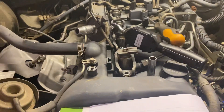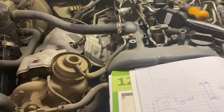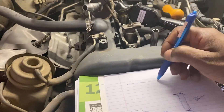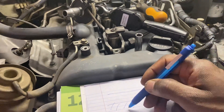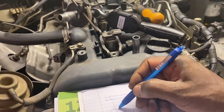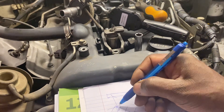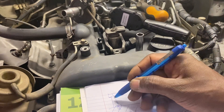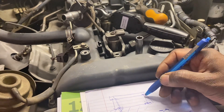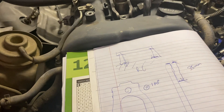These bolts have to be tightened to a certain spec. Looking from the front of the engine, you need to make sure that the saddle is straight. If that's the bottom of the rocker cover and that's the saddle, that distance has to be the same. There's also a little raised platform where the bolts go. When you take that measurement, make sure you get it from the same reference point — either from there to there, or from that raised platform to the top.